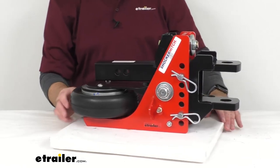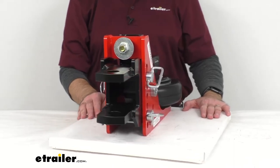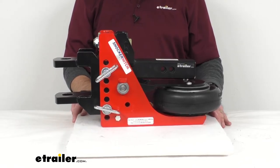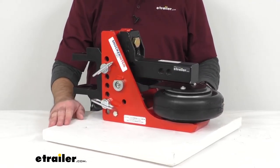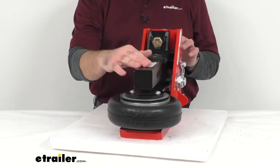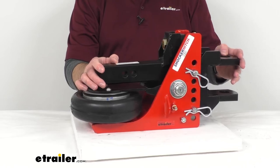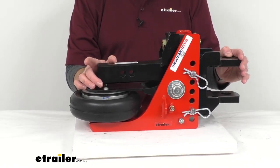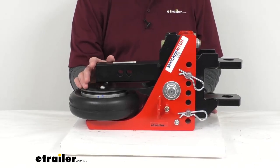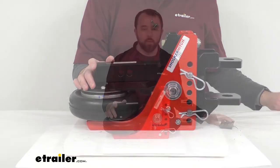Here are some additional installation tips. This does require a minimum of seven inches of clearance from the center of the hitch pin hole to the rearmost portion of your tow vehicle, and the receiver opening should be flush with the bumper or protruding from the rear of the vehicle for best fit. A two inch Shocker air receiver will not fit a two and a half inch hitch even with a reducer sleeve, as trucks with a two and a half inch hitch have deeper frames. A two and a half inch Shocker air receiver will fit a three inch hitch with a reducer sleeve.